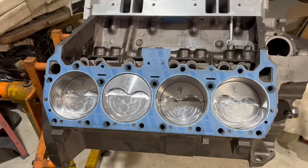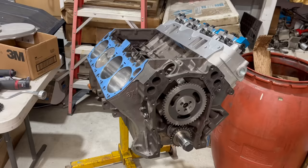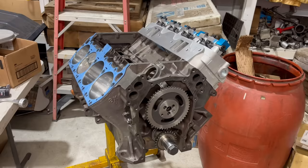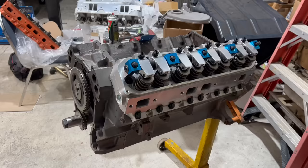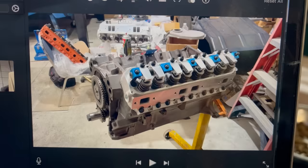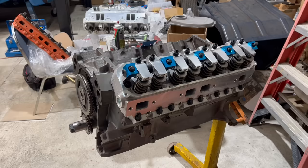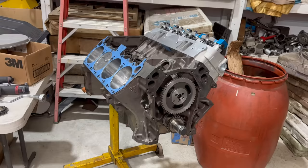So how are we going to solve this problem? Before we cover that, I'd like to cover some recent frequently asked questions — like, why are you using a 400 block instead of a 440? Because that is the original block from that car. For decades, the 451 stroker was the stroker big block build. You take the 400 block, which has the biggest bore, and you use the 440 crank with turned-down main journals. You get the biggest stroke in the shortest block with the biggest bore — a weight advantage and a power and torque advantage. Nowadays you can just buy a stroker crank and have lots of other options, like a 512 made out of a 440.